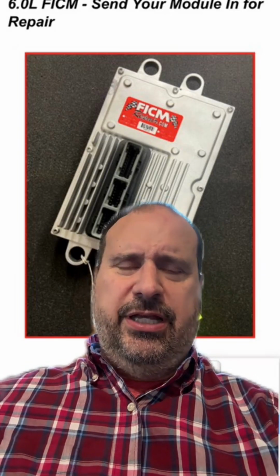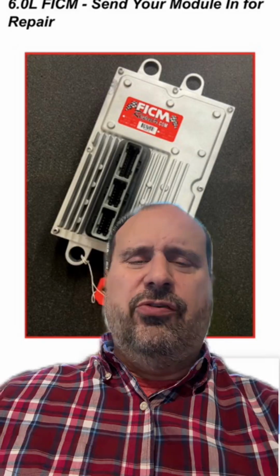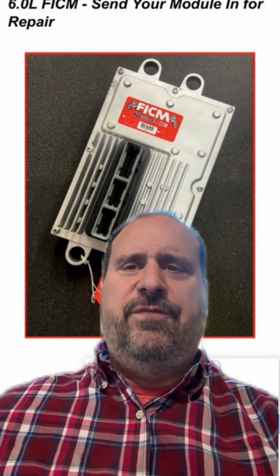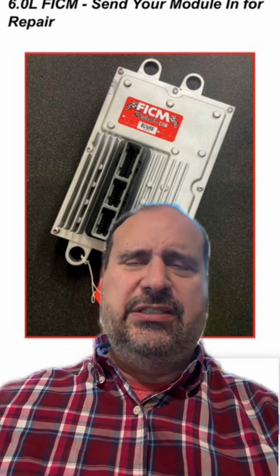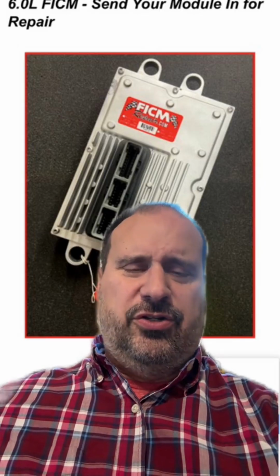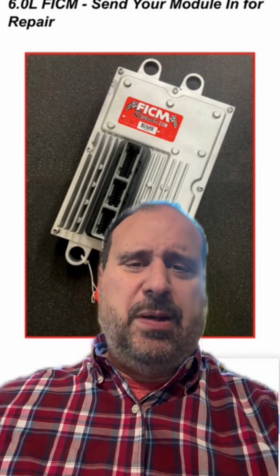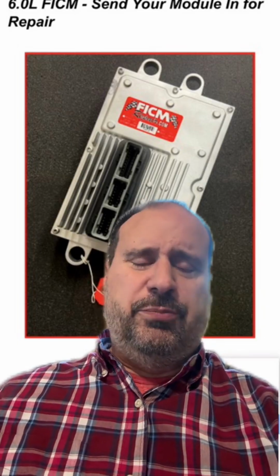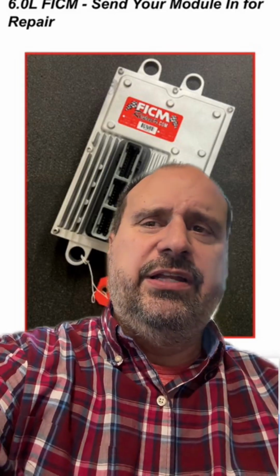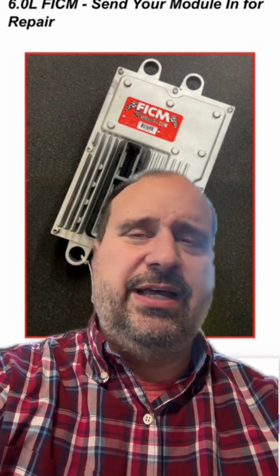So if you have the option to plug it in, plugging it in will make the difference if the problem is sticking injectors. It'll also make the difference if the problem is the FICM, because recognize the FICM has a 30 amp draw on it when it's 21 degrees. But if it was 120 degrees out, which is what would happen if it was plugged in, that's only 3 amps, and it's way easier to put out the proper voltage in a FICM. You need 46 to 50 volts in a FICM to have the thing start. Way easier to put out 46 to 50 volts hot than it is when it's cold, because 3 amps is a lot less flow than 30.